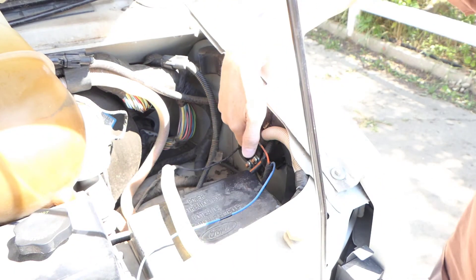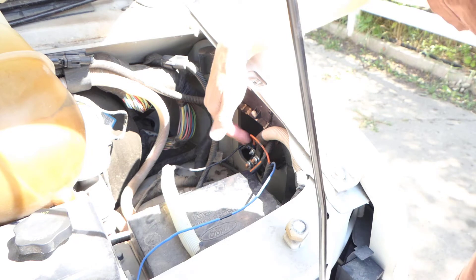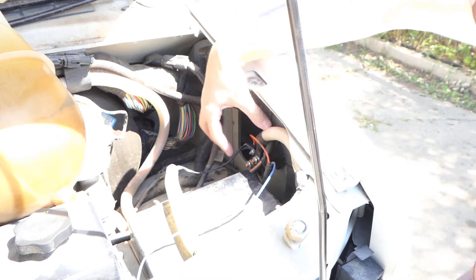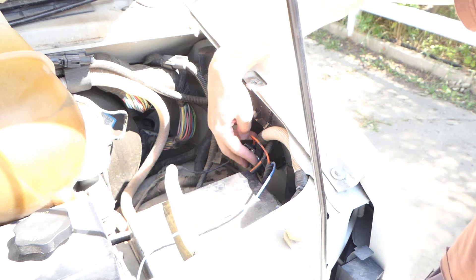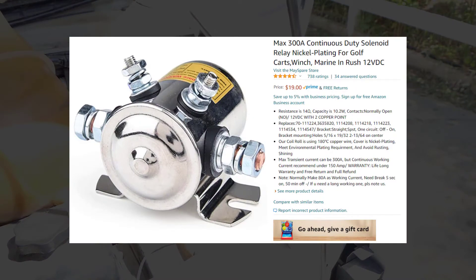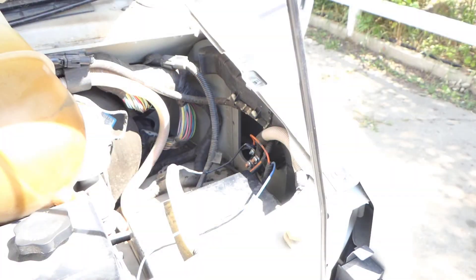We spoke with the customer and let him know that this solenoid is bad. He said he's actually replaced the solenoid already once before and not that long ago. The issue here is that this solenoid is not meant for continuous duty. These solenoids get extremely hot and require a lot of current to operate — they're more meant for short-term momentary use, typically no more than a 50% duty cycle. So when you're driving, especially on a long trip, the key is in the run position, this solenoid is on and activated, and it's going to wear out and burn out. You need a solenoid that is meant for 100% duty cycle.